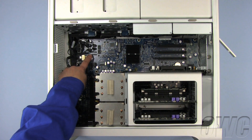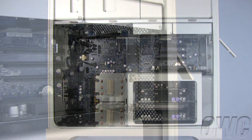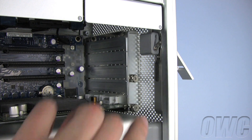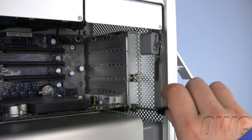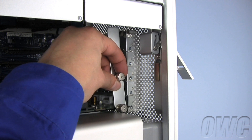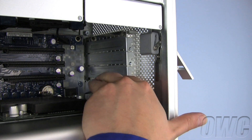The two SATA ports are located here. Loosen the PCI Express cover retaining plate and remove it. There is a tab at the top that the metal plate latches into — you will need to unscrew the two screws and slide the plate down and out of the tab. Now remove the PCI Express dead plate cover.